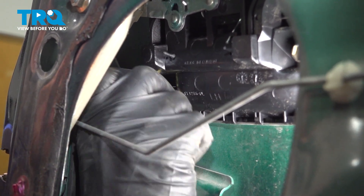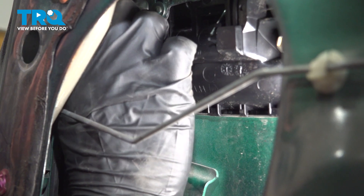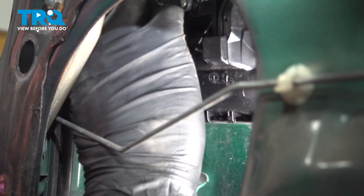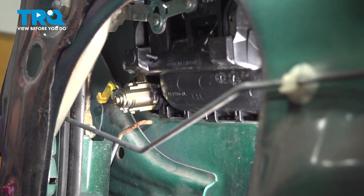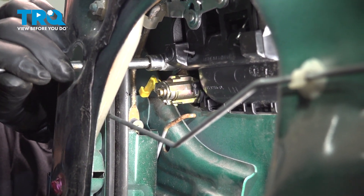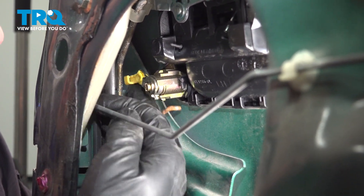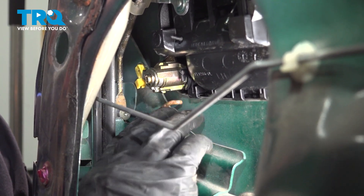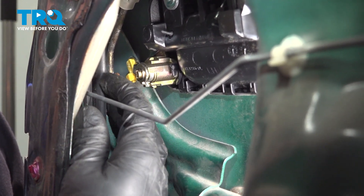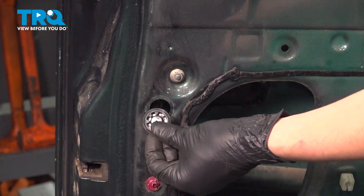Take your new lock cylinder and slide the lock rod into position — it should pretty much fall into place. To lock it in, put that bolt in. It's a little tight to access, but you can see it through the hole on the outside. Start it onto its threads, snug it up, and give it about an eighth of a turn after it bottoms out. Also connect the rod for the lock — push the locking clip backwards to make space, slide the rod through, and lock it in. Don't forget to cap this back off.